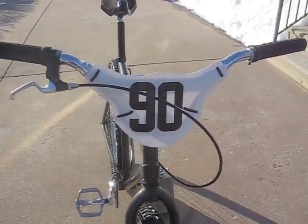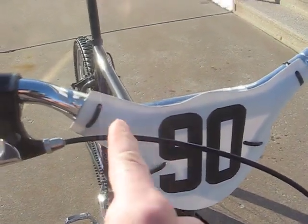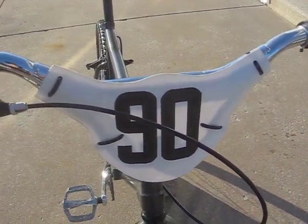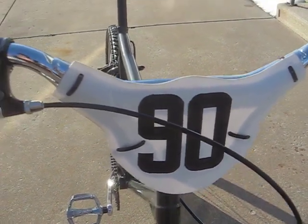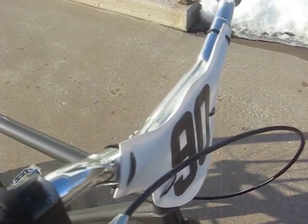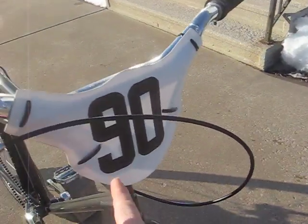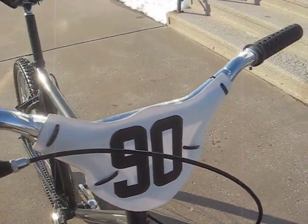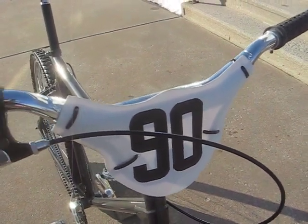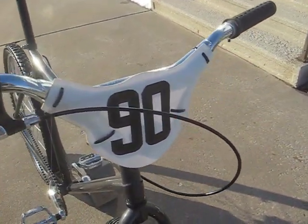I made this little custom racing plate here. It's inspired by the shape of the Haro flow panel. I did heat the wings with my heat gun to try to form them, but the type of plastic I'm using didn't take it too well. It was more curved at first, but when I zip-tied it on there it kind of softened up and didn't really hold its heated form. This is actually a lid to a Rubbermaid storage tote — a good flexible material that was appropriate for what I wanted. I just laid out a pattern, cut it out with a little reciprocating handsaw, sanded the edges, marked my holes, and drilled them.